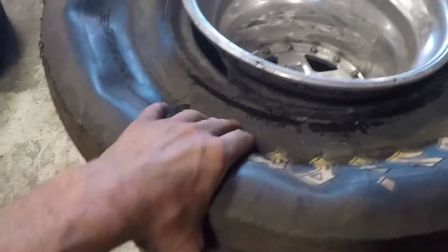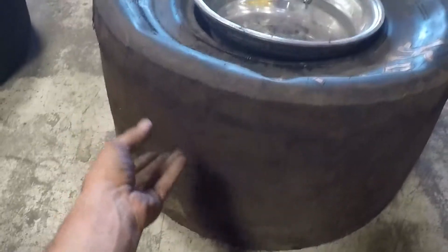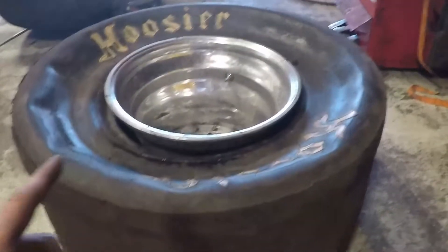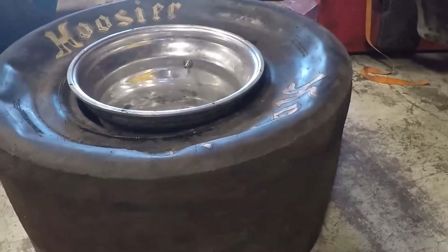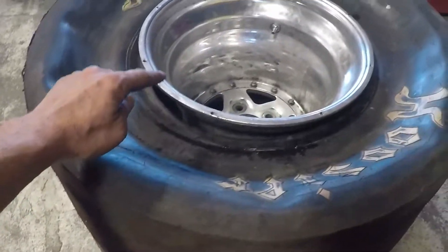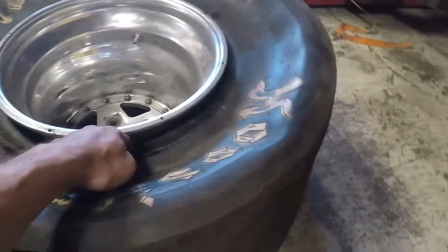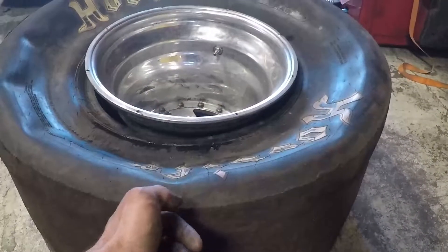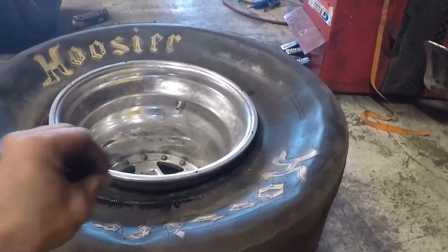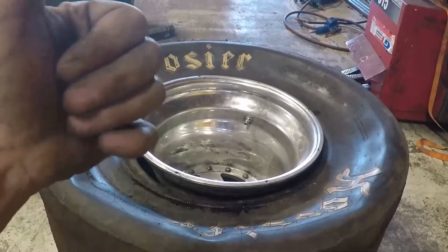Obviously we can't pull this tire up — it's a bias ply tire. We could use a ratchet strap to try and suck the center down to expand it and get it to seat, but that's usually a pain and doesn't really work — only works on smaller tires like go-kart tires. So with this, we're gonna spray some ether in the tire, make a little trail with ether, light it, and if it doesn't get sucked into the tire I'm gonna kick the side of the tire to suck the air in. Then it's gonna explode and seat the wheel, and hopefully nothing bad happens.